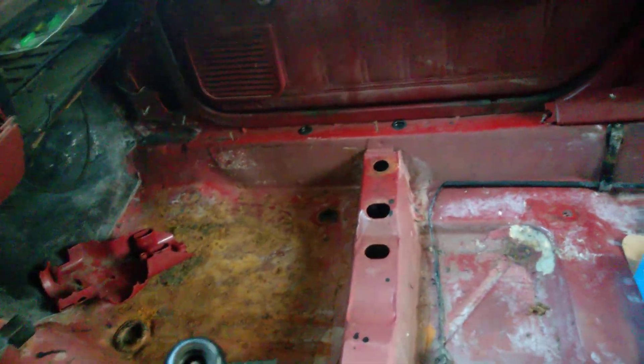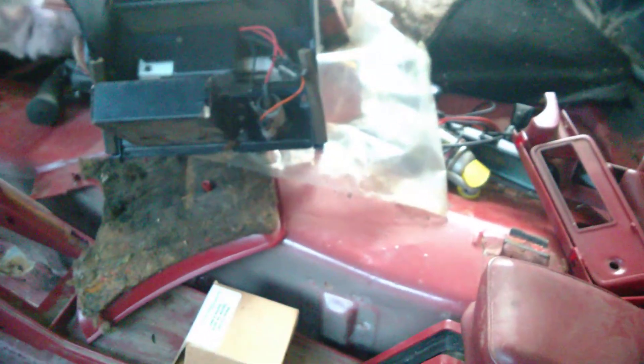Got a bit of leakage down here in the floor pan. I don't think I showed you guys this because there's still carpet down here. Here are the floor pans — they look a bit nasty, rusty looking. But that's all pretty much surface rust and whatever buildup. No big holes. These are seat holes and frame bits, and that's a drain plug hole. But it still sounds pretty solid, so might not have to do a whole lot of patching. There is one major hole still under there.